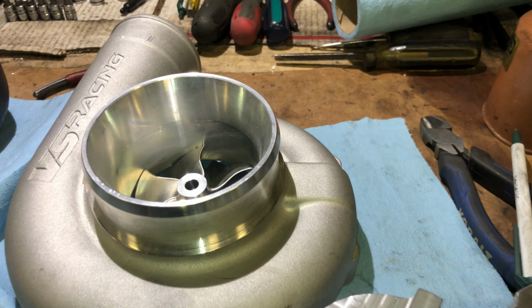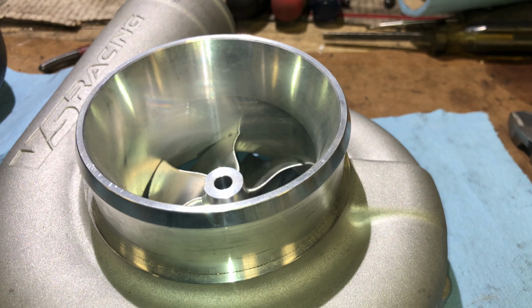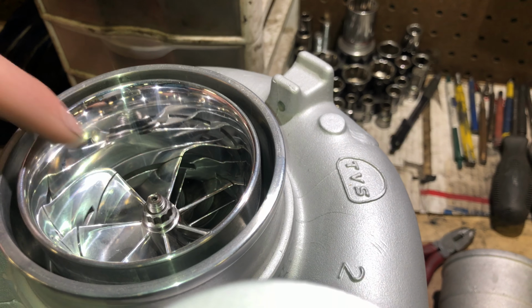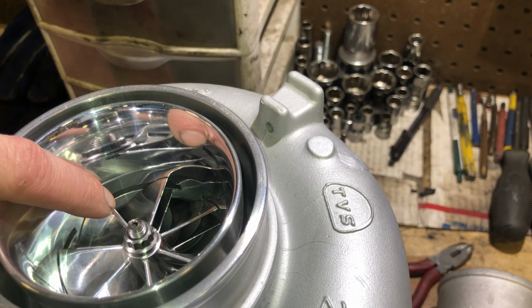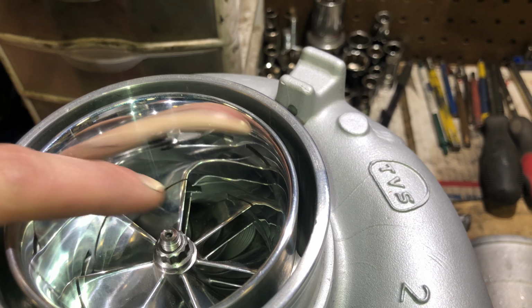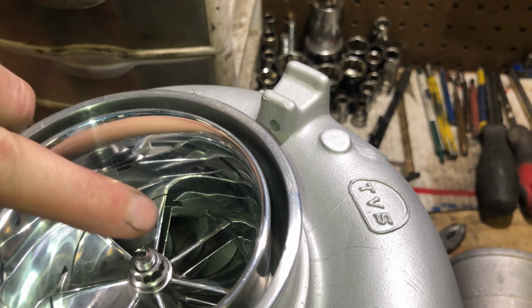This one, I'm going to go to 180 thousandths, but I am not putting the groove so deep. So if the groove width of this groove is wider, you would want it to be closer to the top of the compressor wheel. But if it's more narrow, like 100 thousandths, then you'd want that groove to be farther down towards the minor blade in the bottom here.